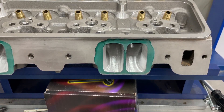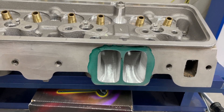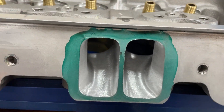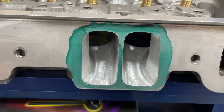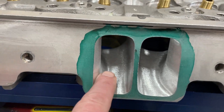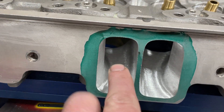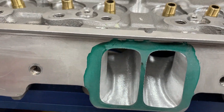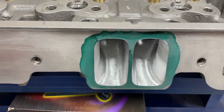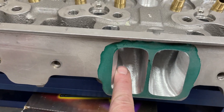I've been more aggressive with these heads before, but this time I've been a bit more tame. It also changed how I did some of the short-side port work since I was worried about hitting water — even though I'm probably really, really safe. I did open up the slot; part of that involved thinning the wall on one side so I wouldn't have to remove as much from the other. The pinch is still pretty small — about 2.4 inches.